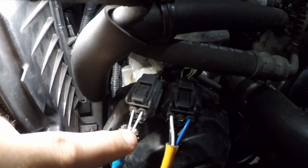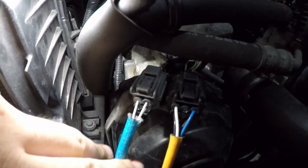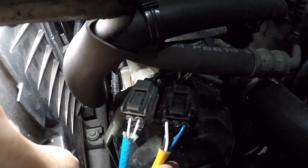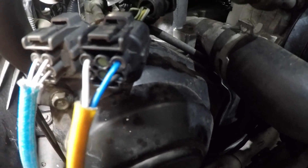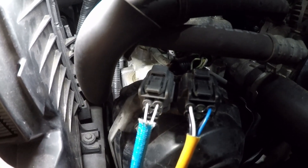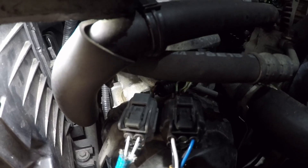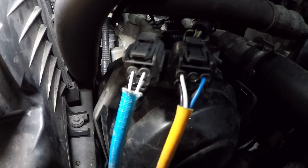We're going to plug into the two same-colored wires - it's pretty universal. For the heater circuit, both the front wideband sensor and this rear sensor use the black wires as the heater circuit. We could get the wiring diagram to see where the 12 volts come from, or to identify which two wires are the heater circuit.